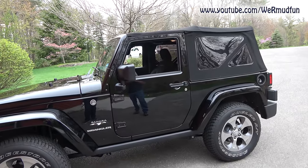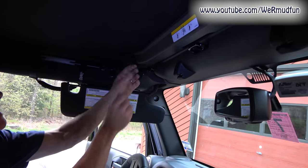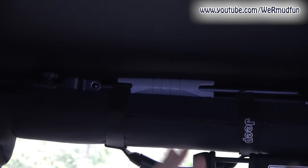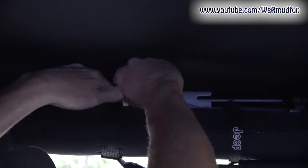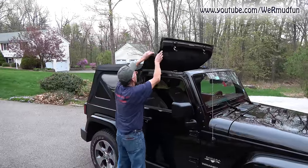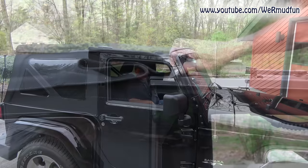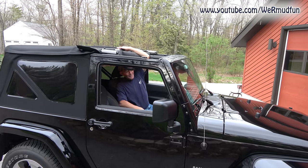Now that we have it on, how do we take advantage of the sun rider? To flip up the sun rider: disconnect here, disconnect here, same on the passenger side. Put them together. Up here is a sleeve — the sun rider sleeve — that allows this piece to flip back; there's an elbow under there. Slide it forward on both sides. Then just lift it up, fold the material out, and lay it back. Jeep has straps they recommend wrapping around it so it doesn't come flying back on the highway. A lot of people just leave it and grab it to pull it back when done.